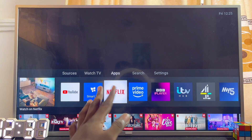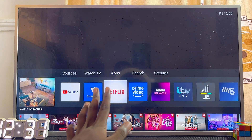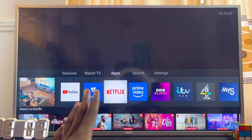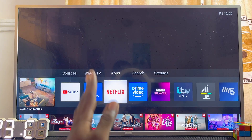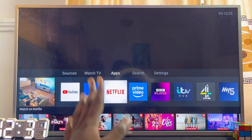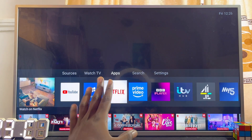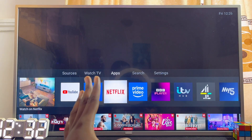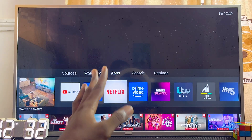There are basically three ways to go about this, and either one of the solutions I'm going to offer will definitely work for you. For the first and simplest method, what you want to do is change your current Wi-Fi name and password to the same Wi-Fi name and password that your Philips TV has been connected to before. This works for any Philips TV you have.